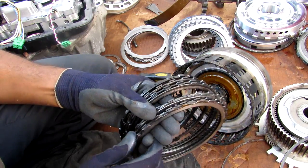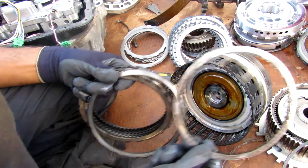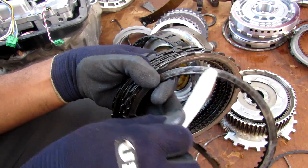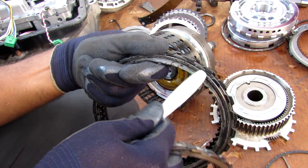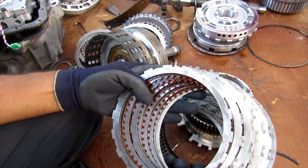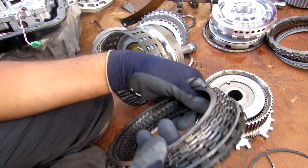The way a clutch pack works is you have alternating clutches: some have teeth on the outside that correspond with teeth on the carrier, and the next ones have teeth on the inside corresponding to the teeth on the next planetary gear set — they form a sandwich that comes together. Taking a look at this clutch band, you can see pretty hard scoring on the externally splined ones and a lot of wear marks on the internally splined ones. As you go further down the clutch pack the wear gets worse — the friction material is so thick I can actually scrape it off — and the last one is completely burnt up, just all black. Compared to a clutch pack in better condition where the steel is shiny and the friction material is nice and brown, when these clutches wear out they can no longer hold friction and that causes slipping — in this case in fourth and fifth gear.